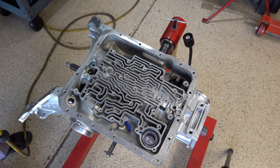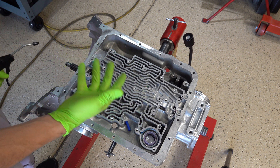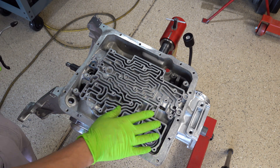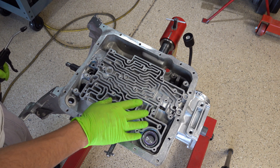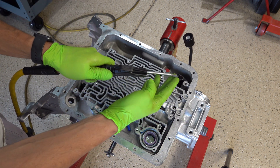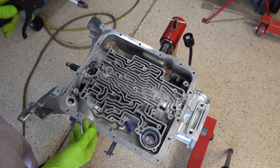Last, we'll go ahead and do low reverse. Now unlike these other circuits which are all bounded and retained by sealing rings, the low reverse circuit uses machine cut square seals, meaning that right out of the gate you should have a basically perfect or near-perfect seal. If you detect any form of hissing other than obvious air whooshing out of the back of the rubber tip, I would be concerned — to the extent I'd go back in and double check.